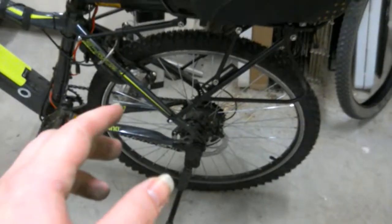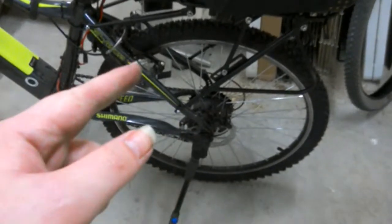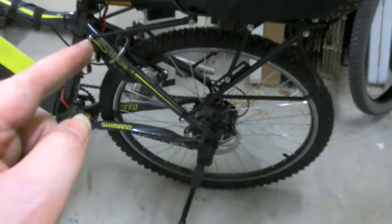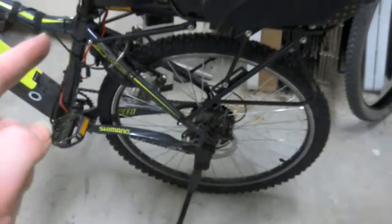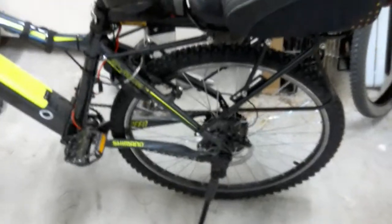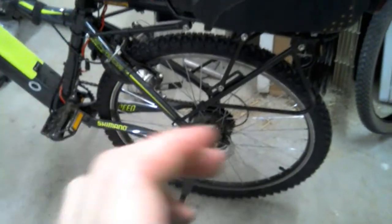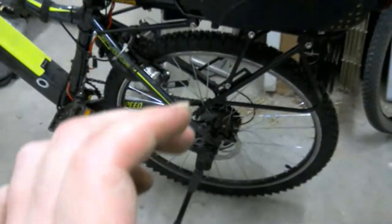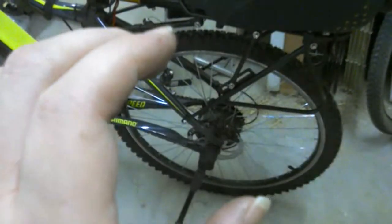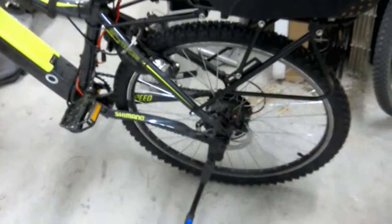This can be either from your axle bolts being too tight and crunching on the bearings too much, or your rotor or your V-brakes are rubbing onto the brake pads themselves and causing the wheel to stop too much. So you'll need to adjust that to have the rolling resistance fixed. Now I know this doesn't seem like a big issue for a lot of people, but it definitely affects your ride distance and your higher speed motion, because that little slowdown will affect your higher speed rolling resistance, and then you'll notice it even in your slower rolling resistance ability.